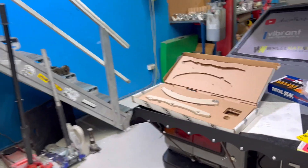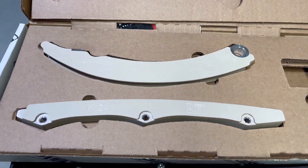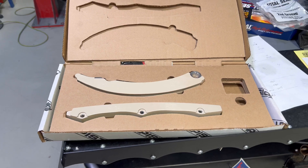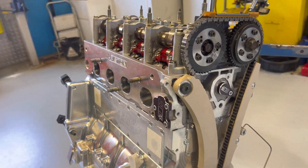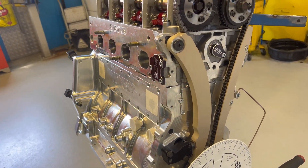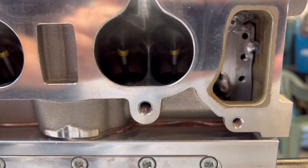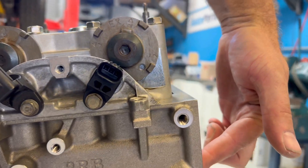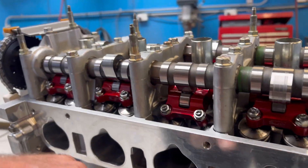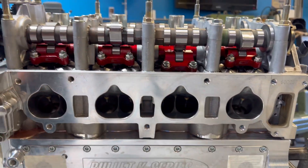The next upgrade we've got is these four-piston chain guides. They reckon they're meant to be better — we'll believe them and throw them in. We never actually re-dialled these cams in when we went to the four-piston head, so we always do it when building a motor. Now it's out on the ground and to be honest they're all smack on. What we've done — it looks a little rough, it's quite hard to get in to do — is a little deflector plate there, which is hopefully going to stop water trying to come straight through from this side of the head and take the easiest path back to the radiator. Hopefully it's going to make that water go around all the combustion chambers and circulate all the way back through before coming out to the top of the radiator.